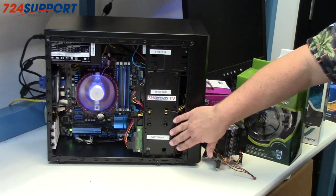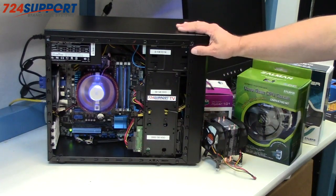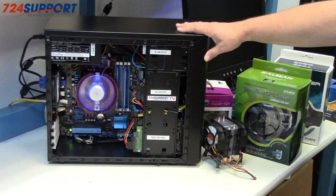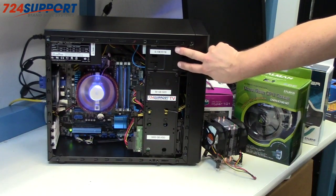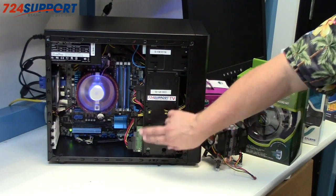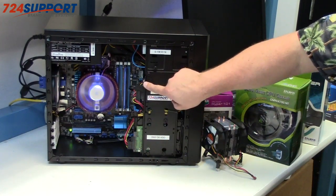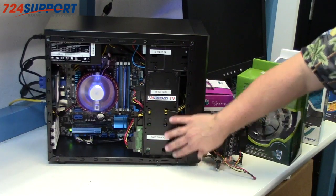In summary, it worked well. Some of the box labeling was a little misleading. You can fit in total a pair of five-and-a-quarter or three-and-a-half inch devices here, and you can fit either one or two three-and-a-half inch drives, or one three-and-a-half and one two-and-a-half inch, or three two-and-a-half inch drives on this mount — but you can't put any other combination than that.